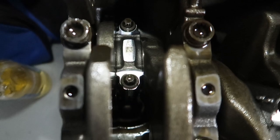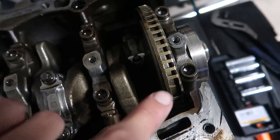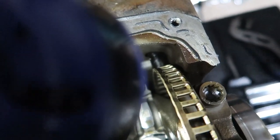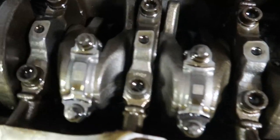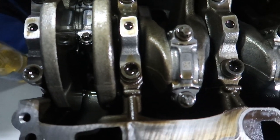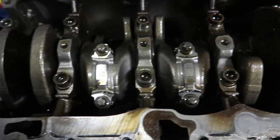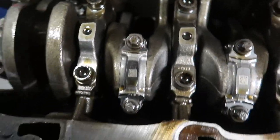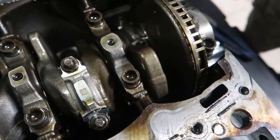There's some connecting rods and a crank - pretty neat. There's a magnet that reads the spacing, a crank position sensor. Sealant goes around the whole thing. The steps in the book literally just say break them loose and pop them out the top, so I'm gonna take the caps off, wipe them off, and mark them one through four. I'm gonna pop them all off, give them a little push, and then tilt the motor to get them out. Getting the crank out should be super easy after that.